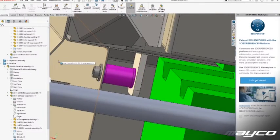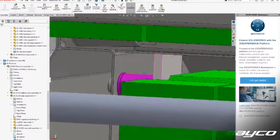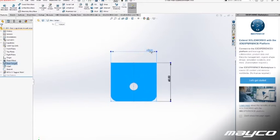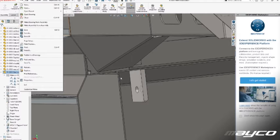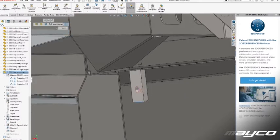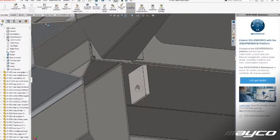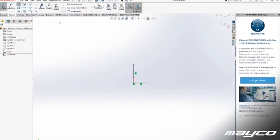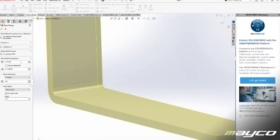So two things I want to add. First of all, if you look at the disc brake and on the other side the sprocket, then you also realize maybe that if the rear axle is torsioning, so the left wheel is higher than the right wheel, then the sprocket might hit the battery pack. So of course that is something we don't want. Therefore I don't like that torsioning, and that's one of the reasons why I really don't like a solid rear axle. But finding something else is quite difficult at this point. Maybe in the future I will find something.